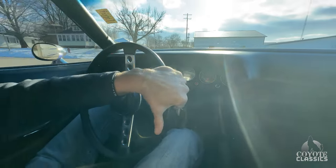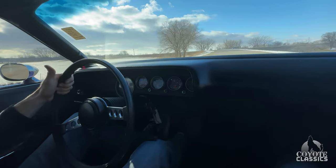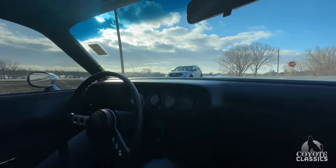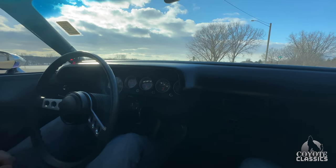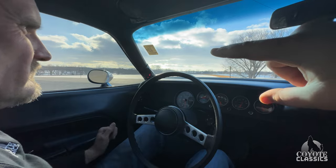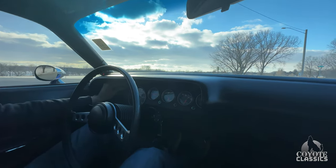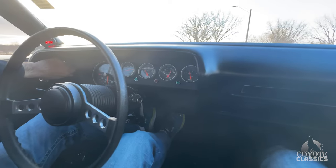Talk is cheap — let's see what this thing can do. Love the gauge setup. It does not have power brakes, but it's got the disc brakes — it stops great. It doesn't idle very well here at a stop sign, it needs something. Oil pressure 80 pounds, temperature gauge works, volt gauge is a little haywire between 14 and 15, gas gauge works. Just a quick note for you guys watching: on the video it looks like the speedometer is blinking — it's not. It's just because when you film a digital display like that it blinks, but it does not flash in person, it works properly. The wiper switch, headlight switch, all that stuff is still all here — they didn't take any of the wiper switch, but the dash looks perfect.